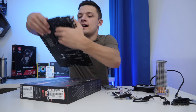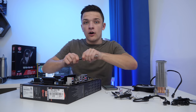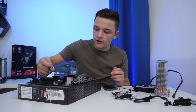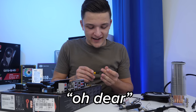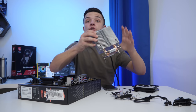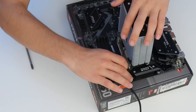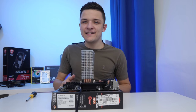I appear to have everything I need. It should be a simple case of popping the back plate on, then grabbing some thermal paste. A small blob around the size of a grain of rice will do — I've made a bit of a mess of that, but it doesn't have to look pretty, it just has to work. Despite that budget price tag, you get a really nice heatsink alongside an RGB and pretty quiet pressure-optimised Deepcool fan. I'm going to leave the fan and the RGB cables over there for now to make our life a little bit easier.